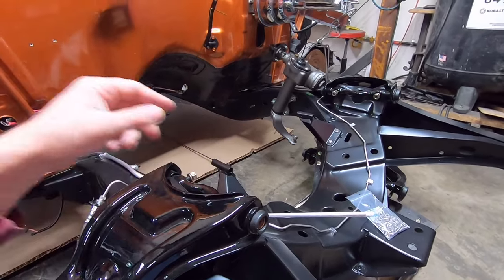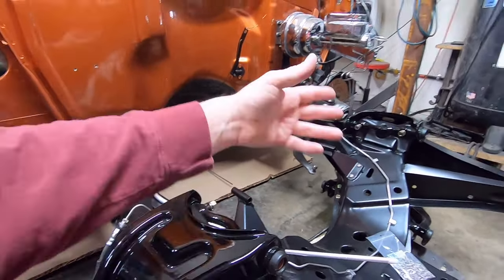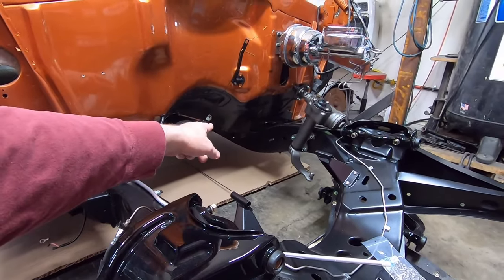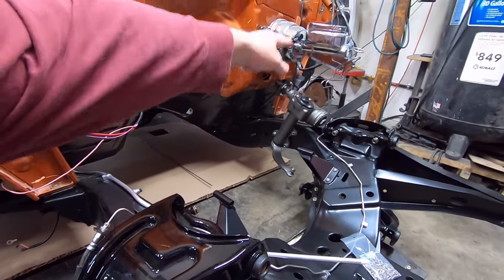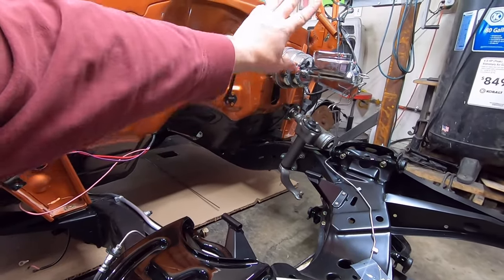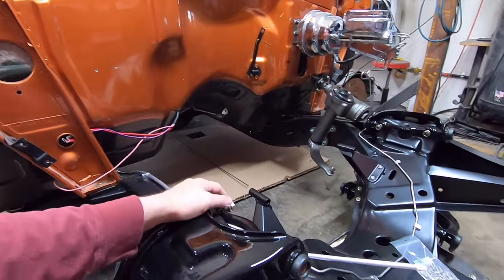What I ended up doing is going down to my local NAPA — they're the only ones that have silver brake lines, because everybody else has those greenish-gray Teflon-coated things. I got a silver-coated 3/16ths brake line, a long stick. I'm going to bend it up today, then drill and tap the frame and probably the front body mount for the brake line clamps. Once that brake line is on and done I can bolt the engine and trans together and get it in the car.